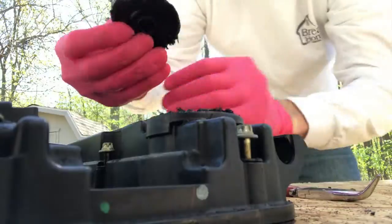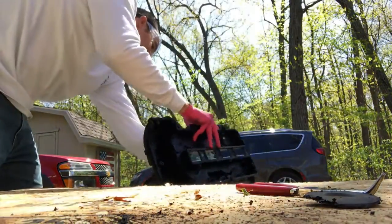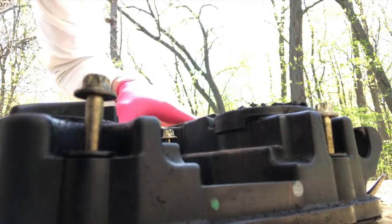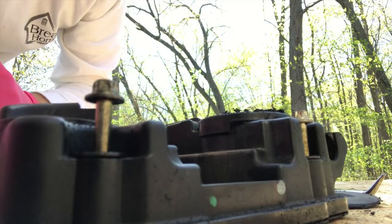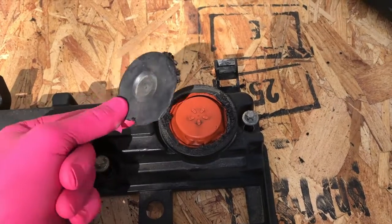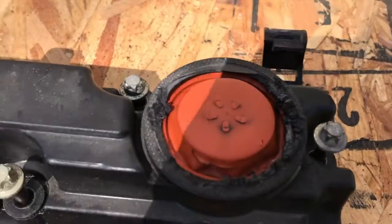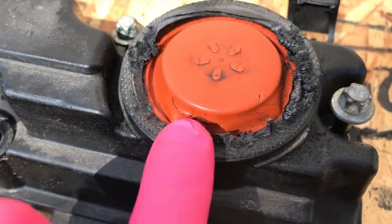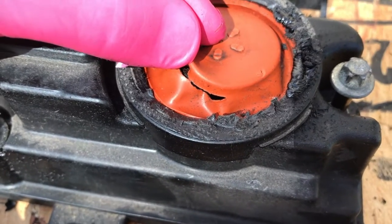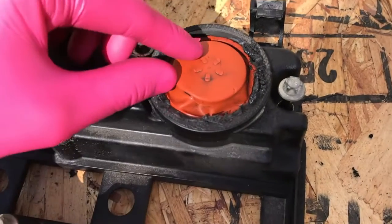I'm going to blow this off a little bit. I have found the actual rip — let me change the camera angle. Here's the plastic cover I just cut off, and here it is — look at that. Let me move the actual diaphragm — that's a major rip, and that is why this part has failed and our engine is bogging down and stalling at stop signs.